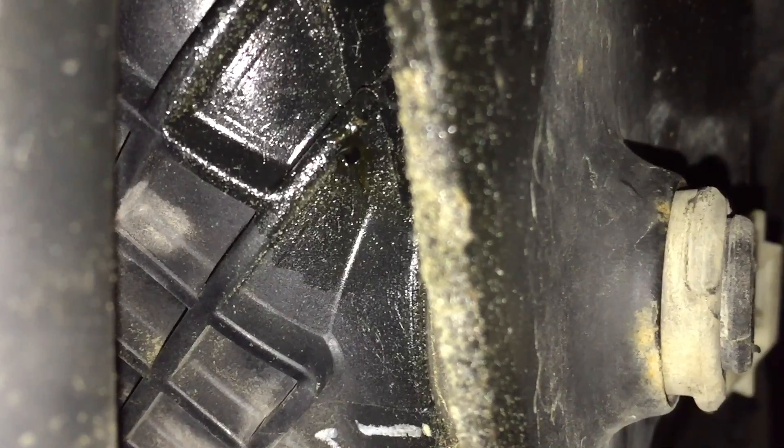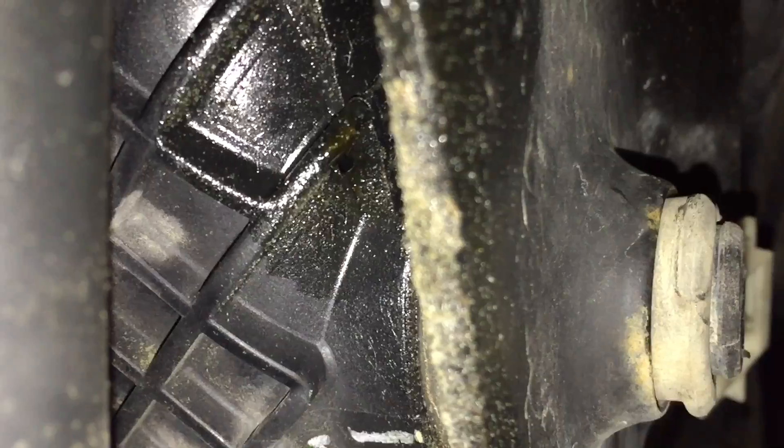Go ahead and start it up. See the oil come out? Every time he starts it up, you get a little bit of oil and water that comes out of there. What happens is, over time, that builds up and the truck misfires. That's only a 3/32-inch hole — small enough so there's no effect on engine performance, fuel mileage, and it doesn't set a trouble code. We don't have any problems with it, other than just a little bit of oil residue around the front of the truck. Small price to pay for fixing the misfire issue.